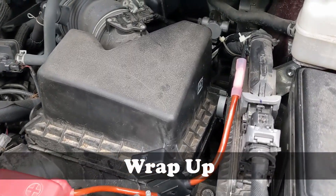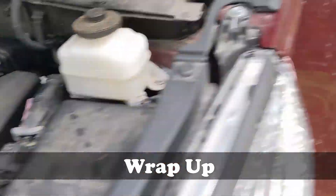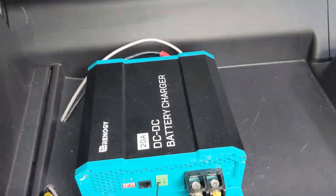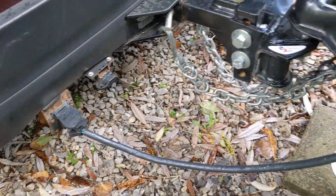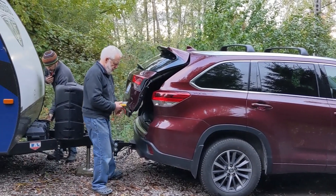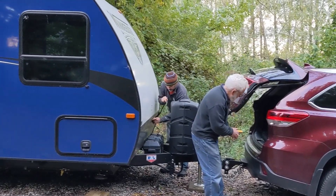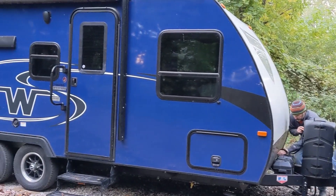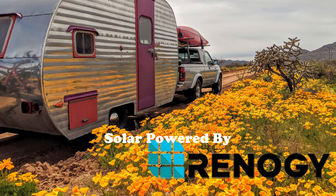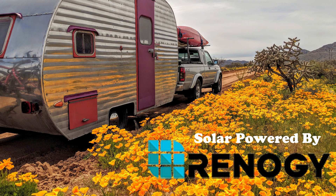Let's take one last look at the finished project front to back. We've connected our charging power with an inline fuse to the starting battery, and that wire runs underneath the vehicle. The D-plus signal wire taps into the fuse box underneath the driver's console and is tucked under the plastic running board to the back, where the unit charges up the trailer batteries via the 7-way connector. Thanks for hanging out with us — it's been fun, challenging, and a great way to connect on a project with my dad. If you've installed one of these, chime in on what you've learned, and if you plan to pick one up, use our promo code and affiliate link below to get 10% off your purchase with Renogy.